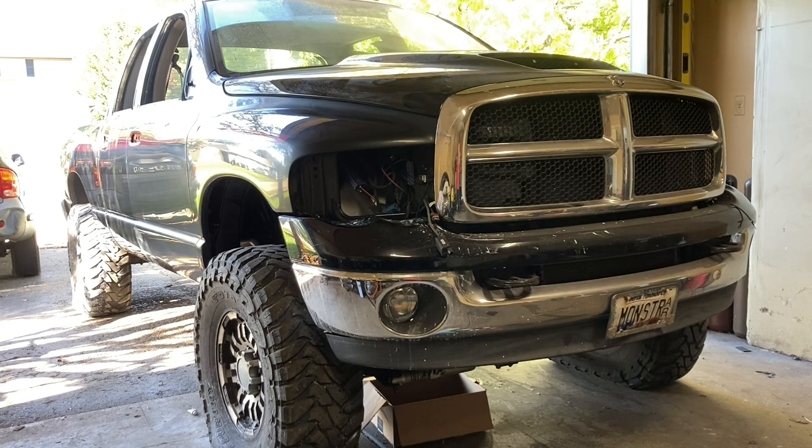After you're done with the 1500 you can see all the little defects that you need to eliminate. I had a couple of runs, I had some gnats, had a small bird — just kidding about the bird. You basically sand that little detailed stuff out, all the little flaws out. You can see plainly after you go over with 1500 anything that's standing out; you see it, you can get rid of it. Then you move on to 3000 and it's already shining. Look at that. Pretty cool.